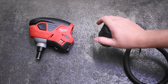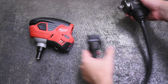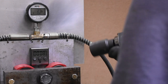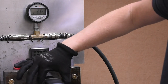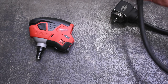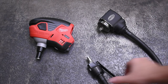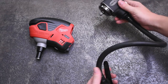Of course, this isn't going to be your go-to impact wrench — lug nuts are not going to be its bread and butter. Cramped spaces are going to be what it does best at. If you're thinking this thing might look a bit sketchy to use, it's important to remember impacting tools are reactionless, unlike a power ratchet that will grab and force your hand forward. You can hold onto this tool with as little as two fingers. With a head under three and a half inches, this definitely falls into an honest palm size category that cordless, at least with current tech, would have a hard time replicating.